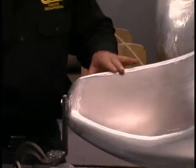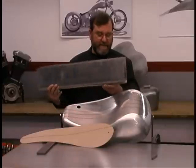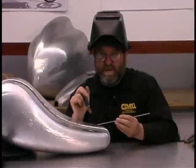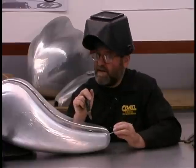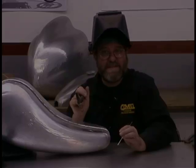I think we're just about finished filing the weld area smooth. We're going to fit the tunnel into the tank next. I've had this tunnel made out of especially thick aluminum — eighth-inch thick — formed on a press brake with a radius die. I've used the TIG welding machine to join the tunnel to the tank. We'll go ahead and weld in the threaded bung for the petcock, then sand this weld smooth and we'll have ourselves a gas tank.